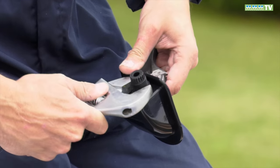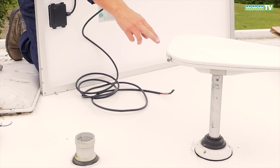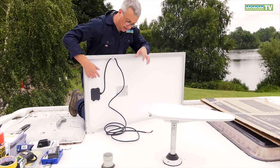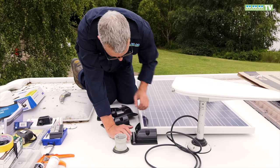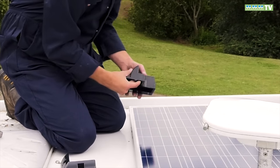I'm Peter, MMM's technical guy. Today I'm going to show you how to fit a solar panel to the roof of your motorhome. First thing: tighten up the gland — they tend to be supplied as a push fit. Put the outer cap on loosely for now. We want to be drilling the hole between the aerial and the outlet for the heating. I want to get it quite close to the aerial because I want to run it down the left-hand side of the wardrobe. The panel sits above these feet, so we need to get it rested on the feet. These are plastic mouldings — there are no holes drilled in them. You bond the outer edge all the way around here and that will hold the panel in place.